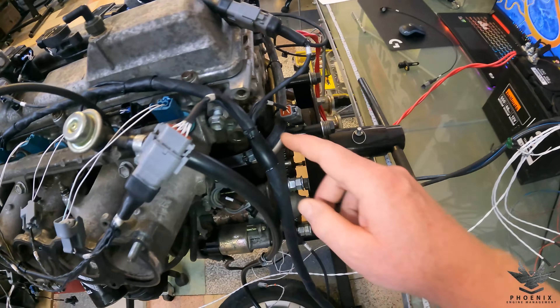Next up we've got our ignition sub-harness. The customer is using Denso ignition coils so we've got all of them over there, and there's a little earth section that comes out the back. Last but not least we've got our wideband oxygen sensor - in this case a 4.2 wideband sensor - so that comes across there, you plug that in and then straight into the exhaust manifold. That's that little breakout section. It then moves up to the next breakout section which goes to the cam sensor. We also have the earth - on the 1JZ you have that flat piece on the inlet manifold where you'd bolt all the earth, so that's where it's going on that particular engine.